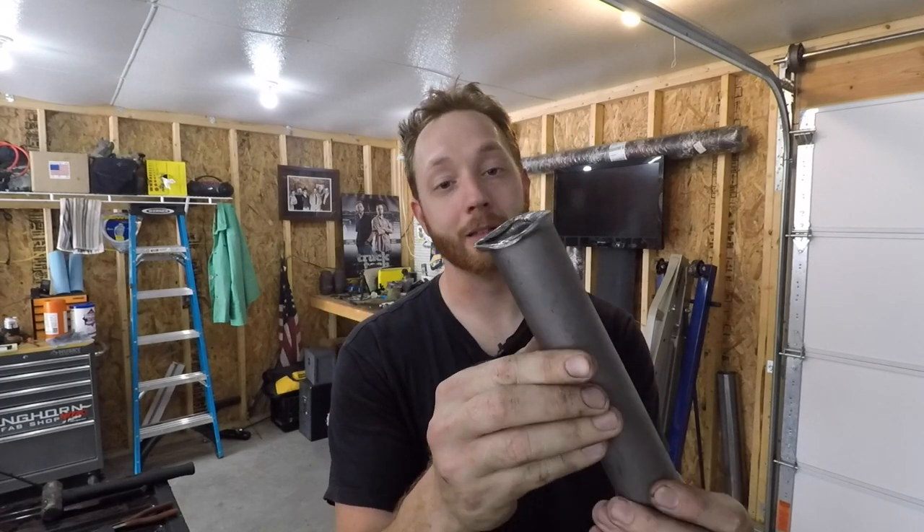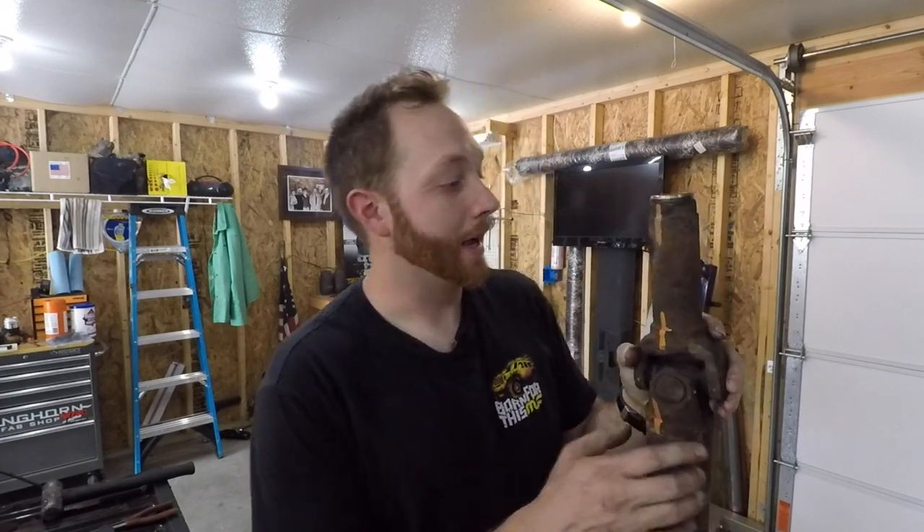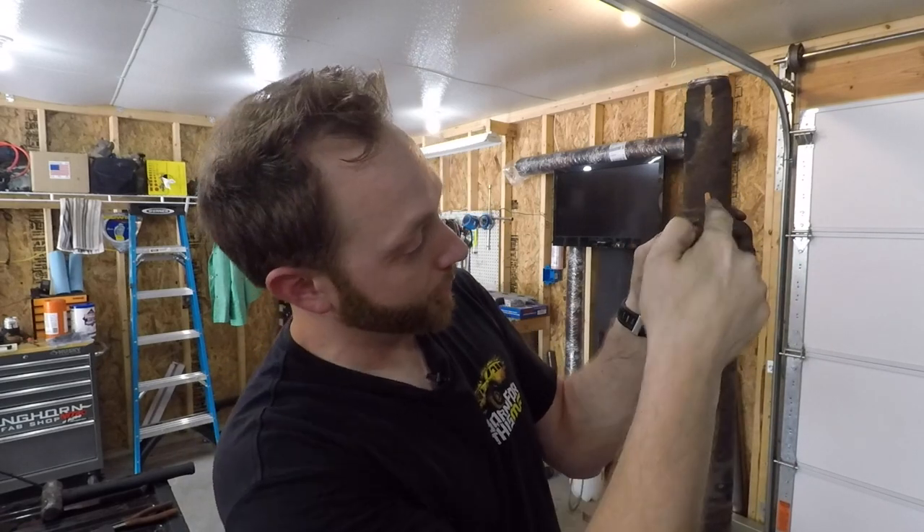You do have to use a fair amount of force - this is 16-gauge header tube and as you can see it's a little bit deformed on the end, but this is the safest way to use a hammer to drive that bearing onto the shaft because the bearing remains perfectly intact. Now, from here, I've got to rebuild the back half of the drive shaft, which basically is just putting new U-joints in. However, there are two things to keep in mind when working with any drive shaft, and that's to mark your orientation. There are three different places where you can twist the shaft around, and if you get it lined up in the wrong spot, your U-joints could be out of phase and the drive shaft will be out of balance. So I made a mark on the front of the middle slip yoke, another mark to show the orientation between the yoke and the shaft, and then a mark on the rear yoke where it goes into the rear differential - just to make sure all the shafts stay in phase and in balance.